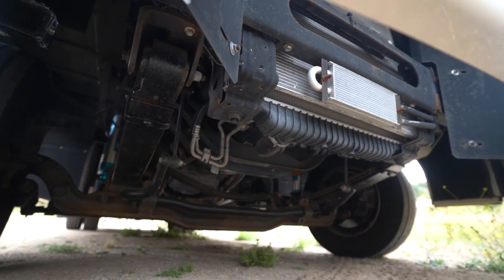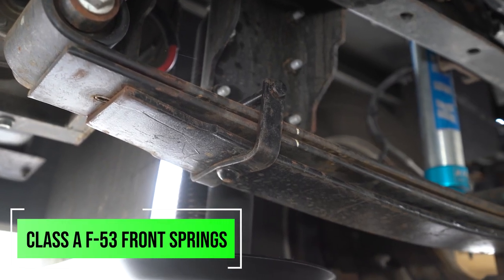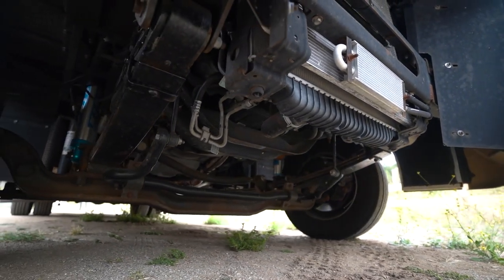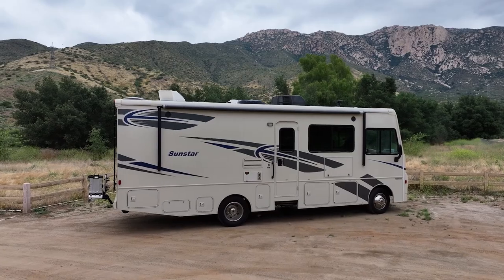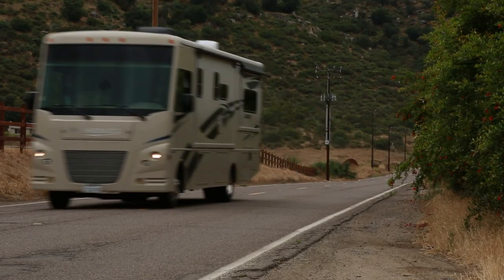In the front we're going to take the same approach — we're going to add a spring to the front of it. So if you have an 18 or 24k coach, you're going to either have two springs in the front or you're going to have a third spring in the front. We're kind of following what the factory is doing, adding a little bit more to increase that weight carrying capacity as well as reduce the sway that typically these coaches have.